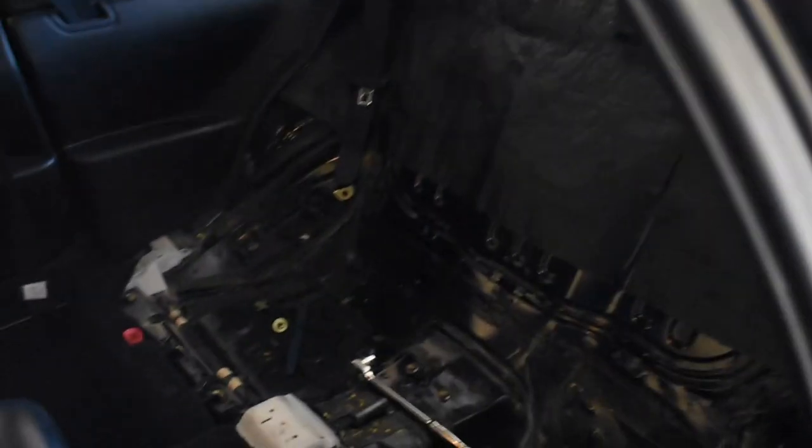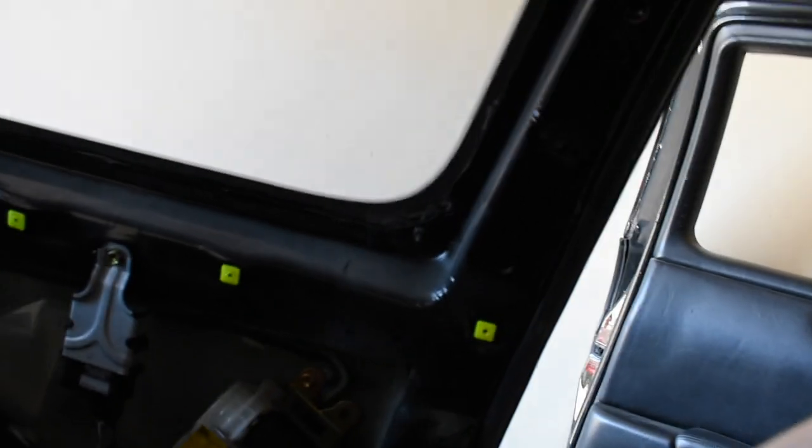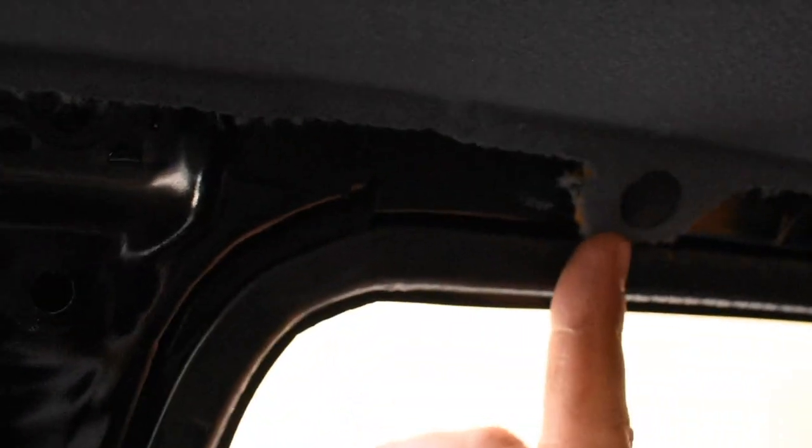We're making some progress. I'm going to show you what it took to get to this point now that I have one side apart. Inside the car you can see there's no more back seat, no back of the back seat. You do have to take this panel off first — it's just a couple of clips and you pop it off, which covers the seat belt. Then this one has four screws across the bottom and pops off with a couple of clips. You can already see this headliner is going to be really easy to take off — it's just a few little plastic clips along the top and it's clipped around the sunroof, so it'll be pretty easy to pop loose once I get this side trim done.